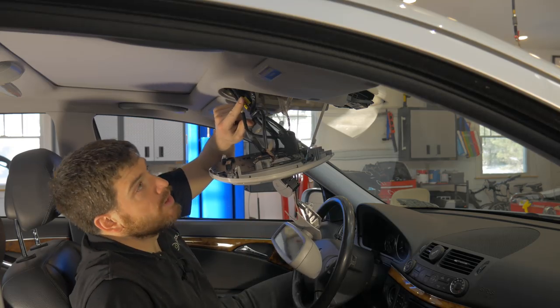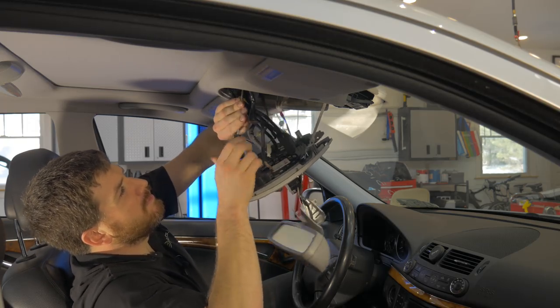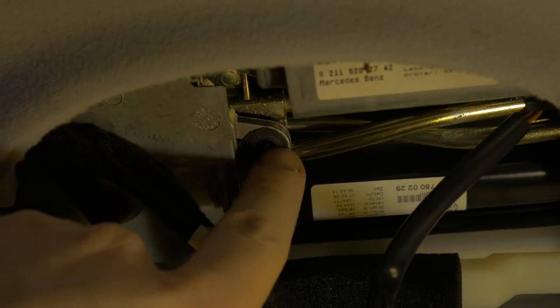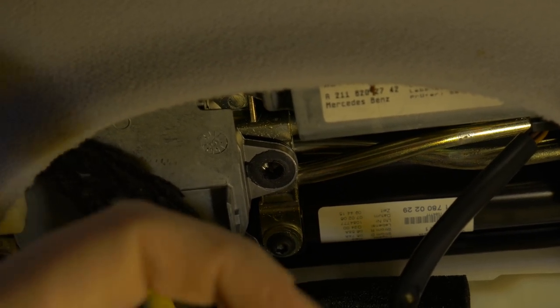What I'm going to do is remove this bolt — and there's one in here as well — and add that spring washer. This bushing used to have a little lip on it, and that kept the tension on this motor. But now, since there's no tension, the motor is able to rock back and forth. I've got my bolt here with my washer, and all I'm going to do is screw that in place. That's it.